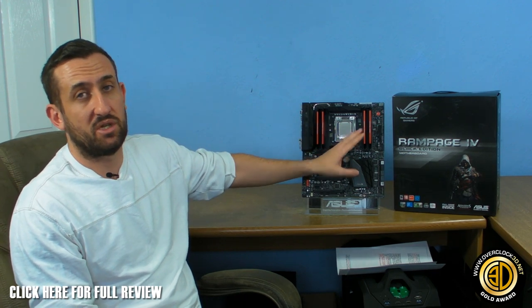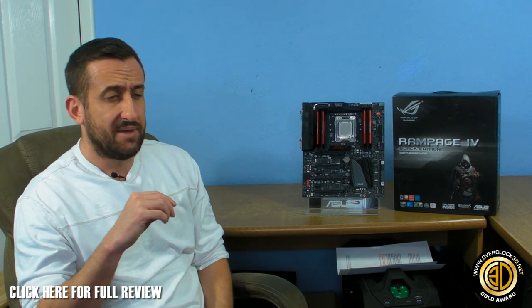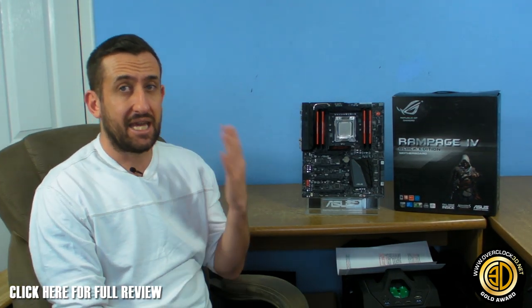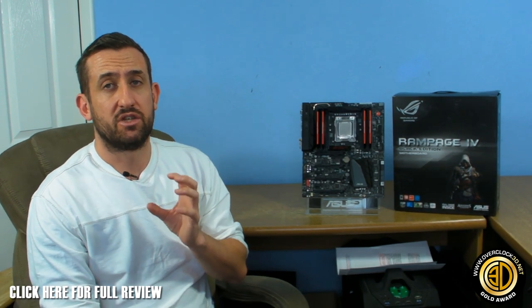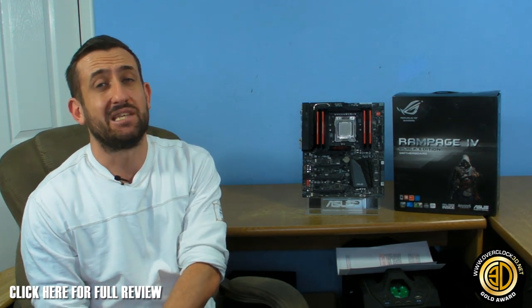That's more than likely down to my CPU rather than anything else, because I tried everything to get it to go, including some crazy VCCSA volts and VTT volts. I really did push this CPU hard, and it's just not in it, basically. And this is another thing that you do need to keep in mind, that the board is fully ready for 2666 and 2800 overclocks, and I've heard of people getting over 3000 megahertz at home with just decent cooling as well. But it's all down to, A, your ability to know what to change in the BIOS, but more importantly than anything else is winning the silicon lottery.